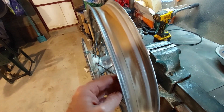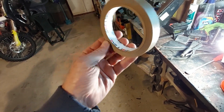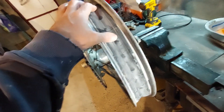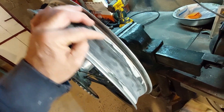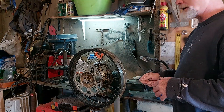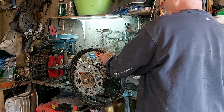To hold the rubber down and help the glue bond better, I used some masking tape — actually a special masking tape for painting cars, a very good brand. I've come back the next day and the tape looks good. The glue is drying pretty well on the edges. I went ahead and pulled all the tape off — it's a big ball of tape. The rubber is glued in there now. The glue feels fairly dry but still a little tacky as mentioned in the product description. It looks like it's dried out pretty good. I'm putting some duct tape over the top to protect it for when I put the tire on, so it doesn't push the rubber sideways.